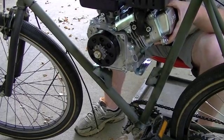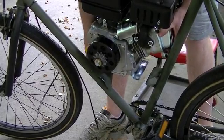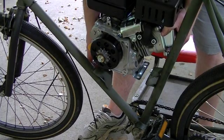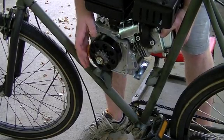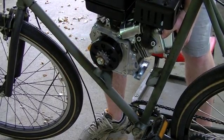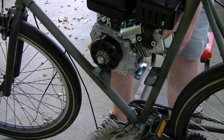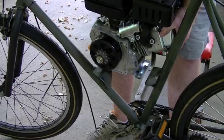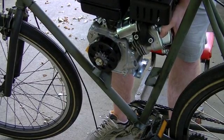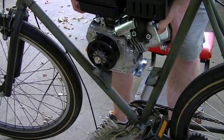So I think I'm going to have to cut those off. This motor is going to have to be way offset to the right — that's the right side sitting on the bike — for the chain line to be accurate. I might have to think about that, might have to make a little jackshaft kind of thing so I can more center the engine in the frame. But the good news is this engine does fit within the frame rail, and I was a little worried about that. I measured and measured, but until you actually set it in the frame it can be hard to tell. Good news is it does fit, so that's a good start.